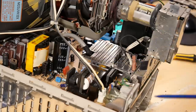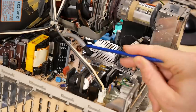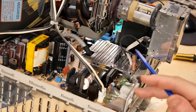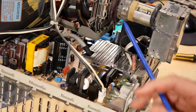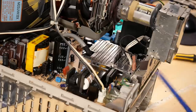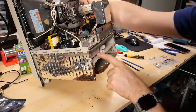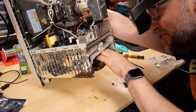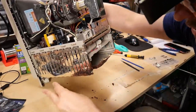Inside this silver can, all the video processing is happening for the CRT itself. This thick gray cable here is kind of like a VGA cord of some kind — the signal is coming in there, goes in here. Three white wires are right here, and this is the output that goes to the neckboard that then drives the guns on the CRT. This machine has a bit of a tiered architecture where it's on this middle level here where the hard drive and floppy drive is. I can see there's a hard drive tucked way back there, and somehow I need to sort of start taking this apart.